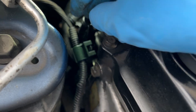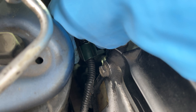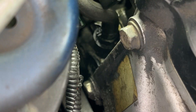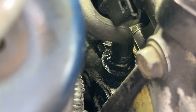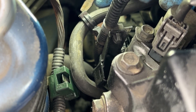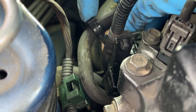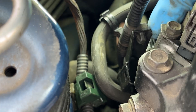If you go to the very back and look past the green connector, all the way down there is the PCV valve — and that is actually a source of a lot of leaking that happens in your engine. The first thing we're going to do is remove this green connector. Just take your thumb and pry it outwards, then pull it up and off. Now you can see the hose that leads to the PCV valve. We're going to undo this little hose clip — just take a screwdriver underneath it and pop it out — and that allows you to pull the hose away from the bracket.